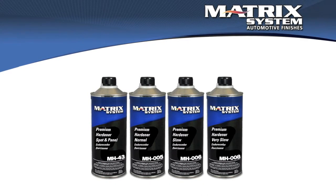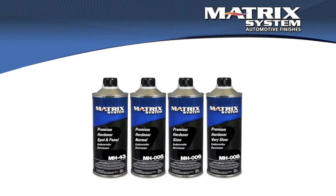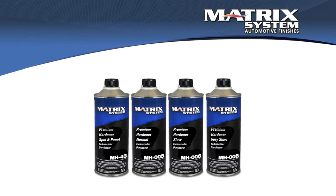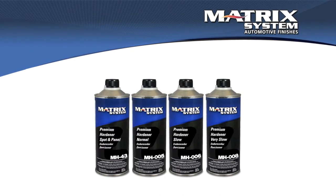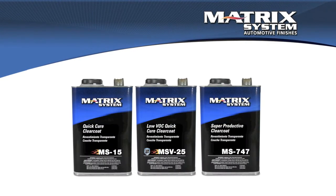With that in mind, there are four different hardeners for most clear coats. We go from the 43, which is appropriate for a small job in cool weather where we're only going to be spraying for a couple of minutes, and then a larger job overall where we might actually be spraying for a total of 10 minutes. We're going to need it to stay open and level longer, even to absorb our own overspray. There are four hardeners for most clear coats, but what about some of the clear coats that only have one hardener?